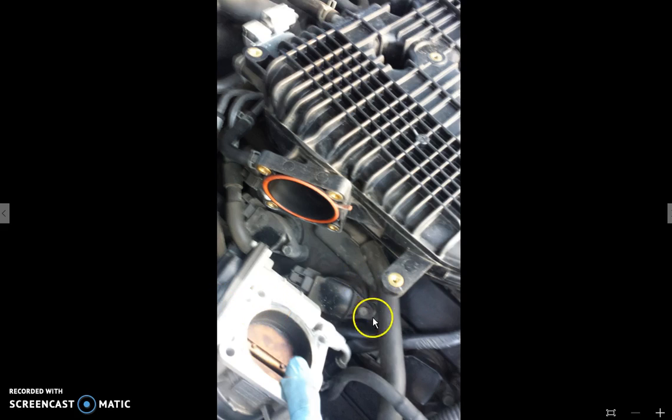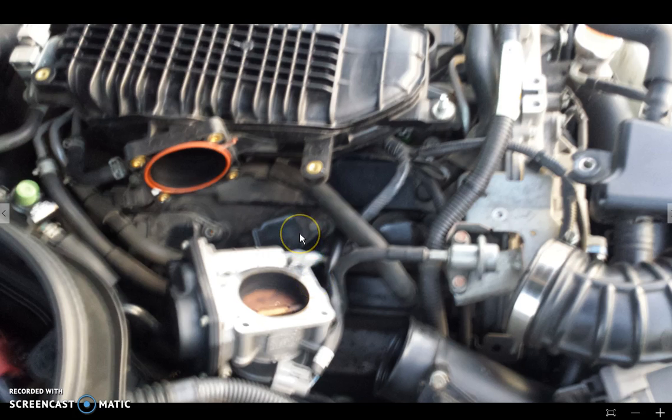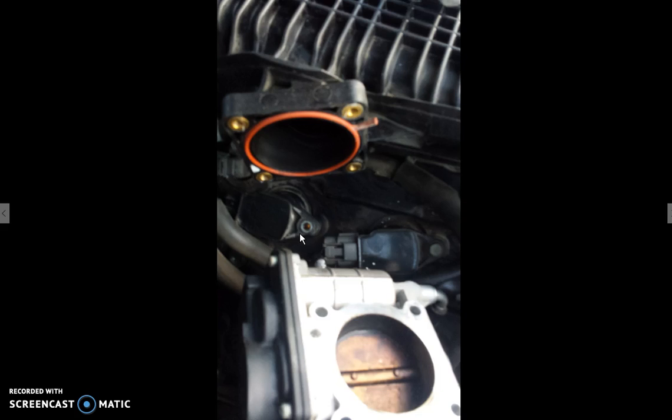And voila. Here is spark plug coil number 2. And there is the third one. All is revealed. So once we got that out of our way, we're just taking out that bolt. And there's this little wiring harness. We're going to take that out too. Swap that plug out, and then boom, now you can see where I've taken out the third one. This one's a little tricky to get to. You just need to be crafty with your fingers. Get it in there, you got it.